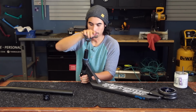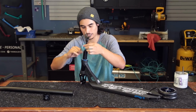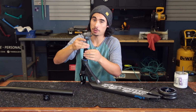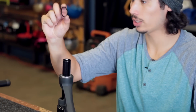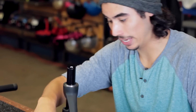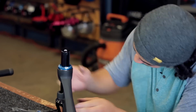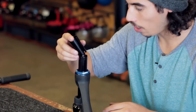Oh yeah, much better. But going back to the dust cover rubbing against the deck, we then have to put a bigger spacer. So forget this spacer. I'm gonna use a 2mm spacer. It's slightly thicker. It's gonna definitely open up the gap between the deck and this dust cover. Bam, look at that. Perfect. Now we proceed with the compression system.